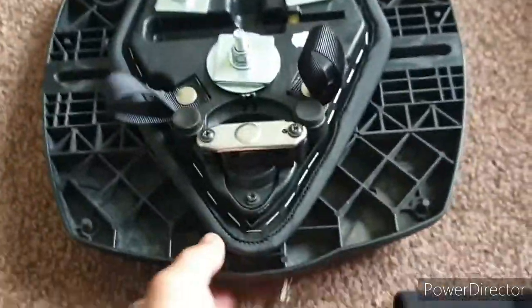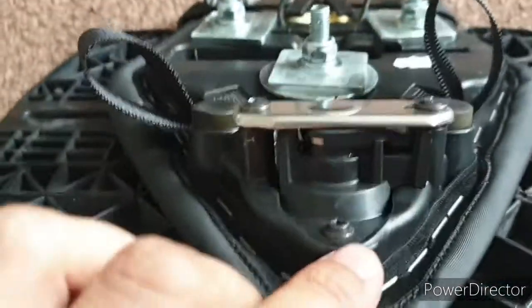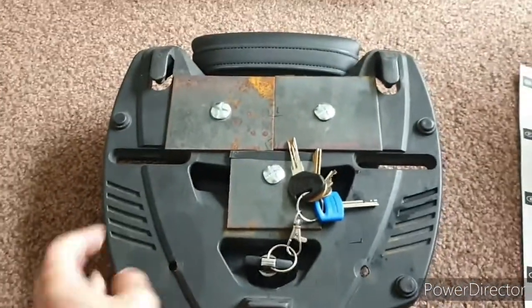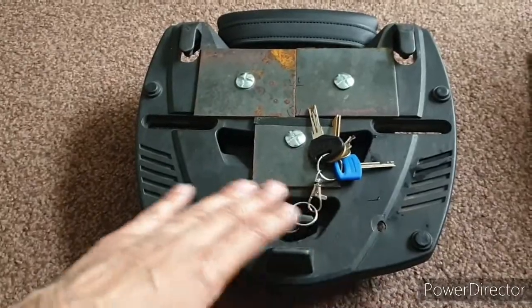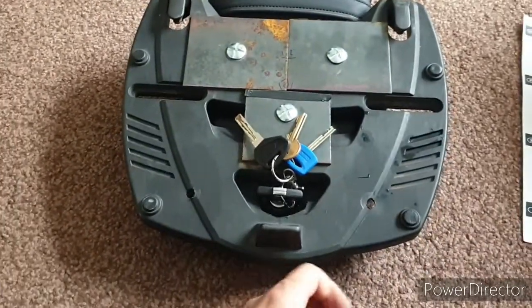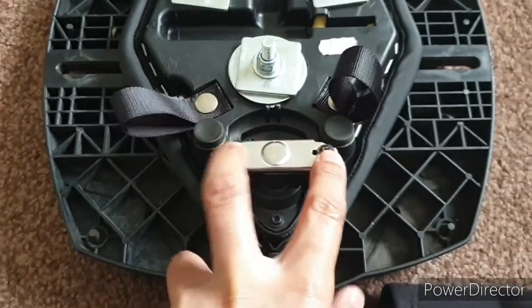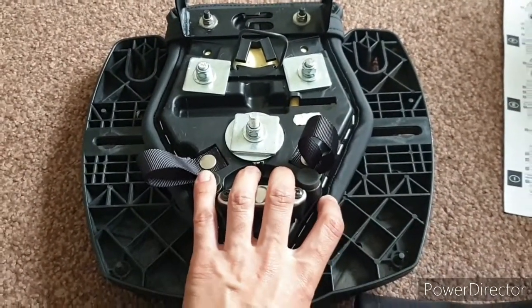Once it's locked down, it wobbles quite a bit. When you look at the fastening mechanism, all you've got is a piece of plastic with a couple of screws and three Allen-head screws, all going into plastic. When you consider that on top of this I want to put a 47-litre top box with all my kit, it's pushing and pulling as the bike accelerates, brakes, and corners. It's all held on with those three Allen bolts and two self-tapping screws. Is that a risk I'm willing to take on a 1,500–2,000 mile journey across Europe? The short answer is no.